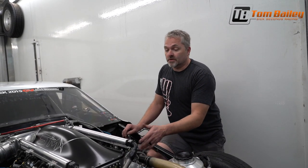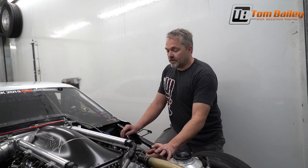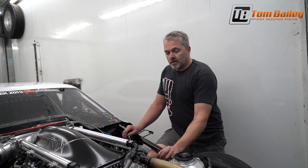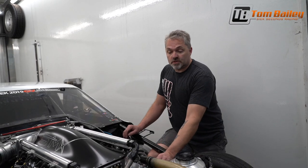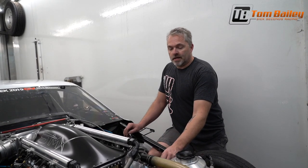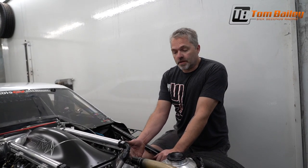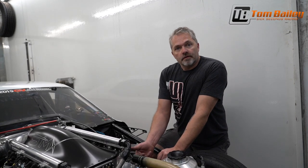It's broke. There's something wrong. So I'm going to go into it and figure out, oh, this thing is not right. I'll feel that real quick. Well, this thing's either very tight, doesn't have any lash, or it's got a bunch of lash, and I can just feel that just by moving it. So I go in and check out the lifter, the pushrod, the rocker, the cup, the valve tip, the roller tip on the rocker arm.